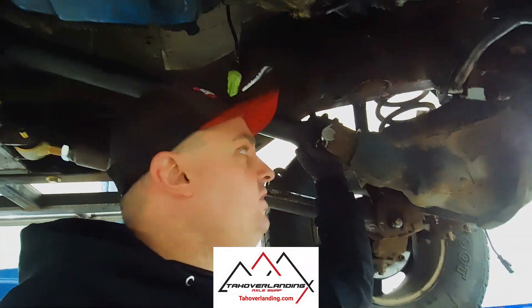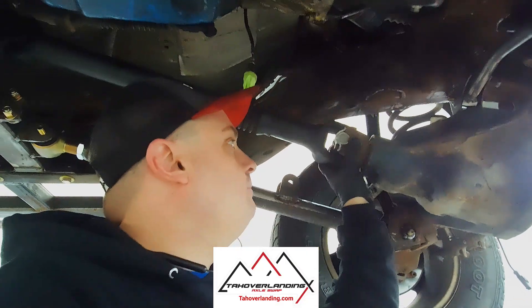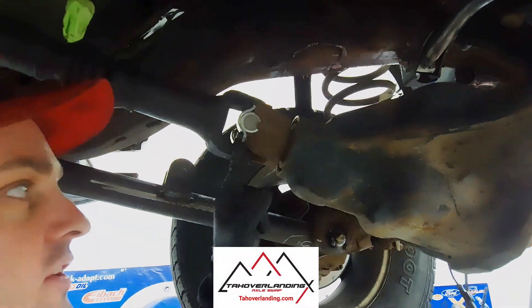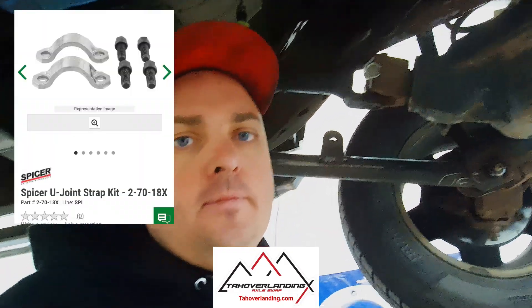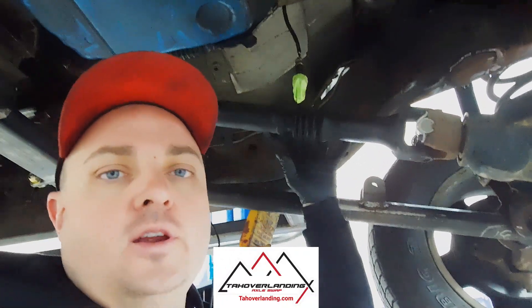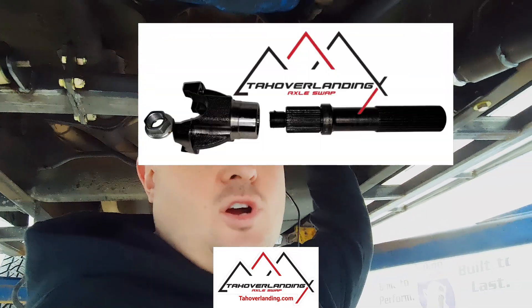Now, U-joint and driveshaft. The axle we use — a 2000 or 2001 Dodge Ram Dana 44 — usually comes with a 1330 U-joint. The drive shafts that work best on these Chevys are 1310 drive shafts, and most of the time you can pick them up from a wrecking yard. You'll need to use a 5-134X U-joint at the axle end. If you don't save the bolts and straps from the wrecking yard, just get Spicer part number 2-70-18X. We use a 1310 because the exhaust and catalytic converter are right there and a 1310 drive shaft is a hair smaller and clears a lot better. The slip yoke eliminator in the Tahoe Overlanding Kit is a 1310 double Cardan slip yoke eliminator.